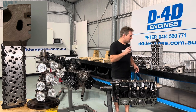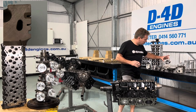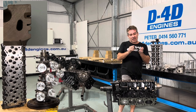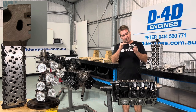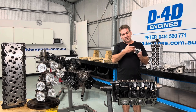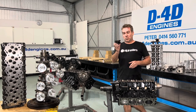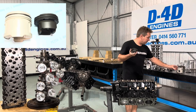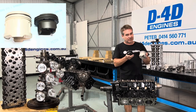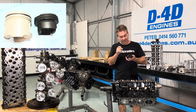The hard part has always been — people ask about a forged piston — it's impossible to make a forged piston for your traditional aluminium diesel because we have an oil gallery we've got to incorporate, and we've got to put a steel insert in to give the top ring land strength. Otherwise, that ring land would just get hammered out. So what we've done is dropped away to a much smaller skirt. Clearly, we can see that the skirt area of the piston is dramatically less, and the ring width is dramatically less. So we've had to rely more on the oil going into the base of the piston to cool it.